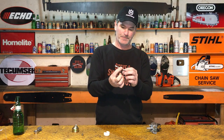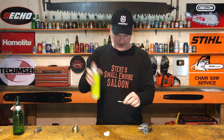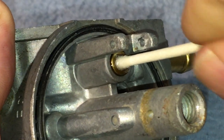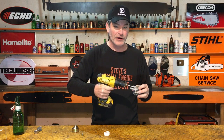Q-tips, boys — look at that. You take a Q-tip; everybody's got Q-tips. But on a lot of these carburetors a full-size Q-tip won't go in there. Just grab a little bit of the fuzz — pull a little bit of that fuzz off of there and it makes that Q-tip a little bit smaller. Put a little carb spray on there — just wet it with a little carb spray — and then put it down in there. It'll fit right in there. Push it in as far as it goes and start spinning that Q-tip around. Pull it back out and look down there with your magnifying glass again. If there's still something stuck on there, try a cordless drill — put your Q-tip right in there like a drill bit, put it on high speed, and you can really hone the bottom of that out.